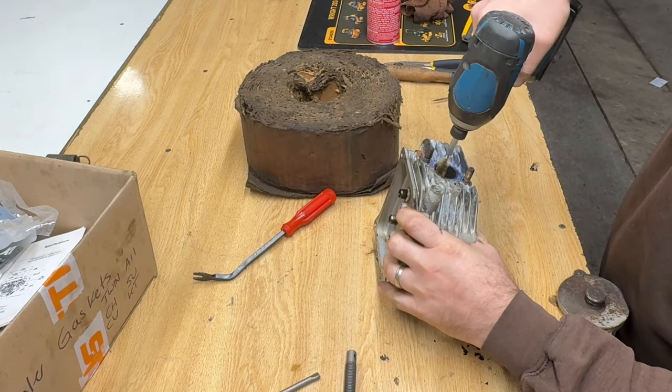When I'm revving it up, if I give it the tiniest bit of choke, I noticed it improved quite a bit. So I think that accelerator pump isn't delivering the shot of fuel I need to get into the higher RPM. I lost my train of thought. Because I gave it a bit of choke, I'm going to rule out that it's the coil issue with the spark advance system. I think that's all working really good. So we'll get the accelerator pump installed and then give that a try again.